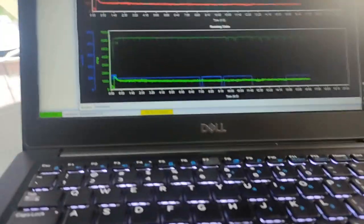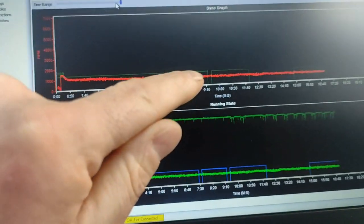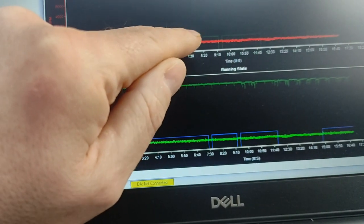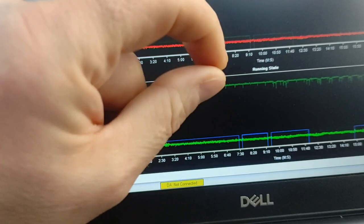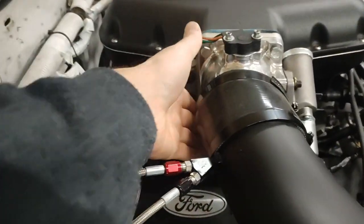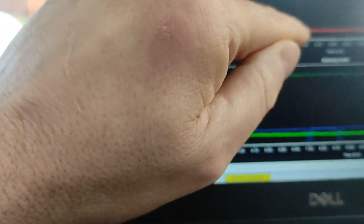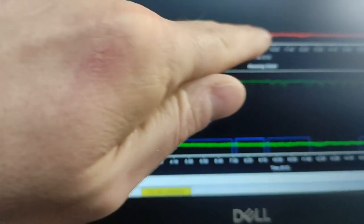Alright guys, so here is the log file. The car ran for 16 minutes. Now the dropouts right here are the throttle position — that's where you unhook the throttle position sensor before you set your throttle stop, so it doesn't change your throttle position voltage. You unplug it, make your change, plug it back in, so it's still in the same spot.